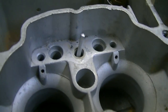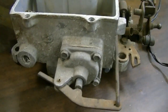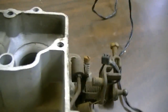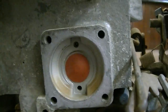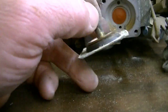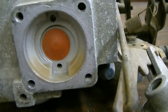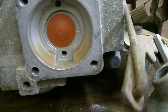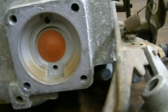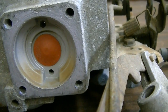And of course we've got the weight and the check ball down in there. I'll pull this accelerator pump off and show you a couple things down there. There's the accelerator pump diaphragm removed - obviously this stuff's old so none of it's any good, you wouldn't want to reuse any of it, but I'm just pulling it apart just to show you. And then you've got this return spring that goes in there, and then you've got this silicon disc that's very important. If it happens to fall out, basically your fuel's not going to stay in the actual accelerator pump well. When you hit the throttle, it's just going to blow all right back out into the fuel bowl.